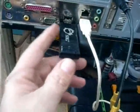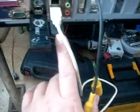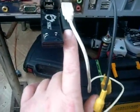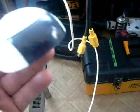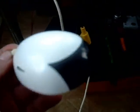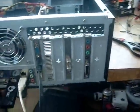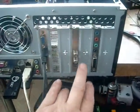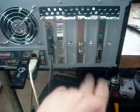We're using a SIG wireless network card to get onto our network. Right underneath is the transceiver for our wireless keyboard and mouse. This other piece is the wireless sender for the keyboard for the MSI TV card, so we can run the remote for the TV card — change channels, change volume, stuff like that. The TV card itself has an in and out jack for coax for a TV or cable signal.